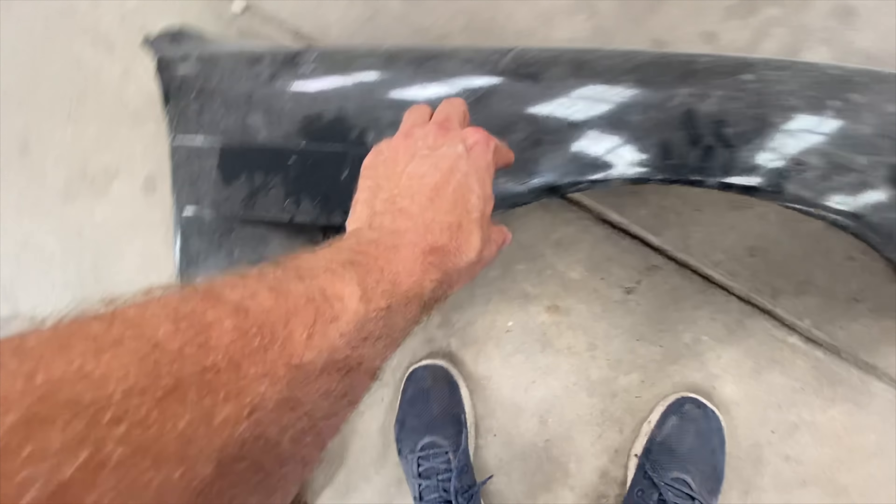265s on the front — I love the way that feels. If you want to do backwards entries and stuff, it's a bit too much grip for that. But I camera car a lot with my cars, which means drive straight behind people. And if they screw up, I need a lot of front grip for evasive maneuvers and braking. If you have 225s on the front and you're driving straight doing camera car stuff — I need to be within about a foot of them most of the time — I don't want to lock up the front brakes and hit them, which I've almost done a bunch. In the 370Z we put 225s on the front and it had no front grip when trying to grip drive. 265s in the back, 225s or even 215s up front would just plow. So it was really dangerous.